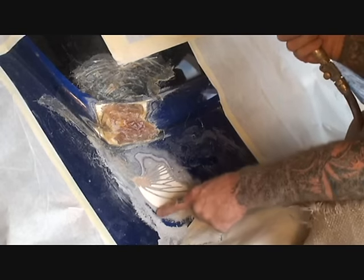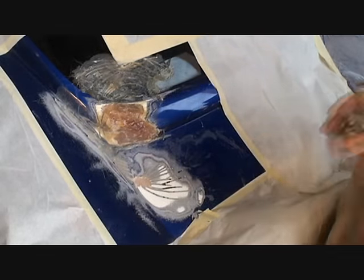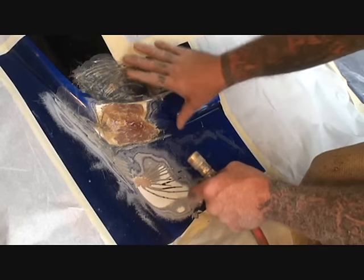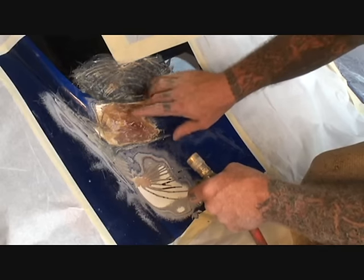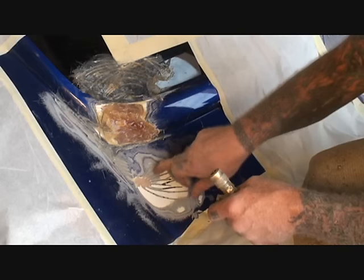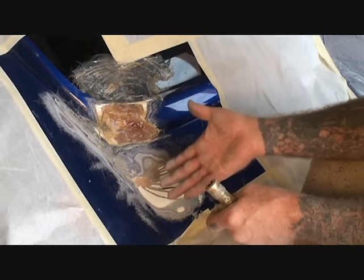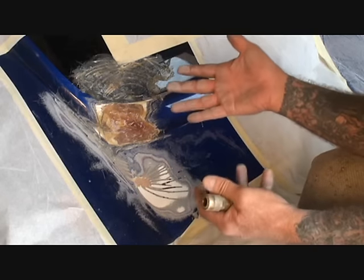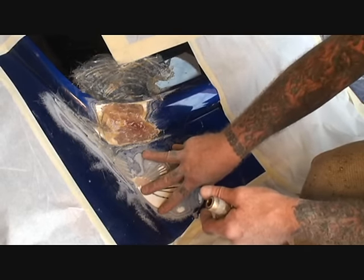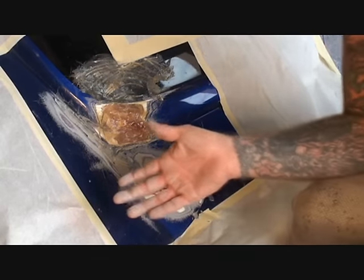Right there you can see where it's filling everything in. I didn't go too far — I'm down to my gel coat so I know to stop. You can see it's all been filled in. I've got a couple of air bubbles here, which won't hurt to apply a skim coat of Bondo over. Using a fiberglass-type bondo mix is a lot better than using dynaglass or regular Bondo because this will never shrink — it'll always stay that way. I'll feather it out just like a dent repair. Fiberglass is different from metal — you can actually make a dip with your sander, and the only way to fix that is to fill it back in. You can look at this like fiberglass welding — we actually welded all that back in.